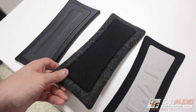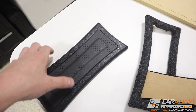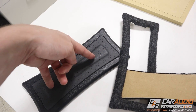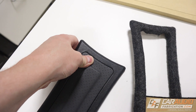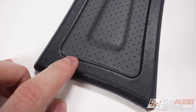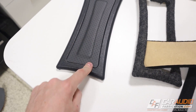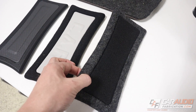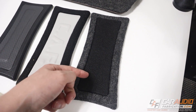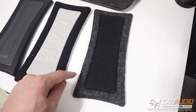If the gap is too loose, your panels just easily fall apart. And if your gap is far too tight, a lot of times you want to use these panels for access to hidden bolts and things like that — but I can't even separate them. You can see when I press this together, it messed up the vinyl because the gap was far too tight. And another important reason to get the gap right: once these are upholstered, there's no going back. We can't rip the upholstery material off and redo the gap.